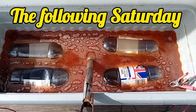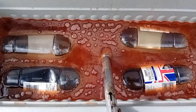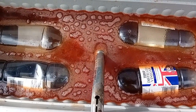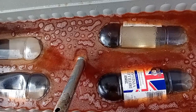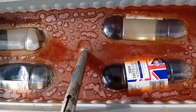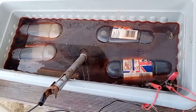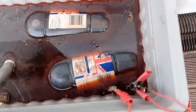This is my solution to my electrolytic solution issue. I added some more vinegar, but I also filled the vinegar bottles up with water to allow them to displace the amount of solution in the tank — Archimedes' principle, I believe. That has managed to cover the handlebars up to the stem, which is fine because the chrome on the stem is fine. It is 25 to 6 in the evening and this has been on the go all day — let's take a look.